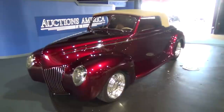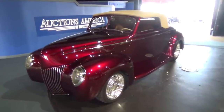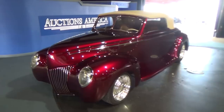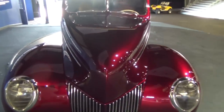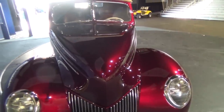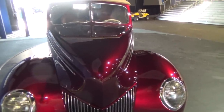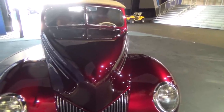The vertical height on the fat fender Fords I thought was always too high compared to the roof line. So we started at the front of the hood and took 1.75 inches out of the hood and kept tapering down until we got to the center line of the rear axle. We were down to 0. Laid the windshield back.